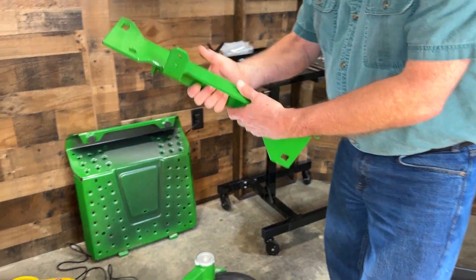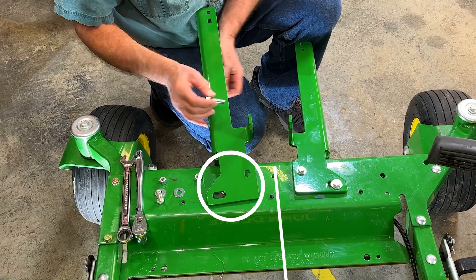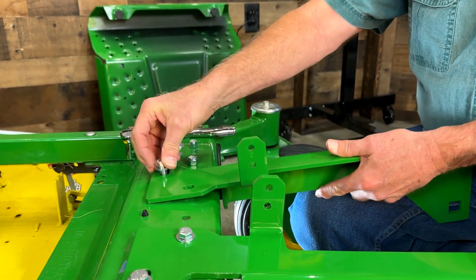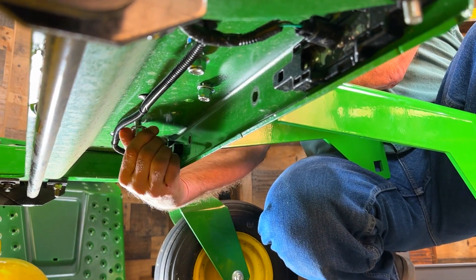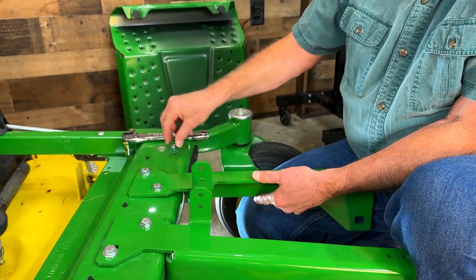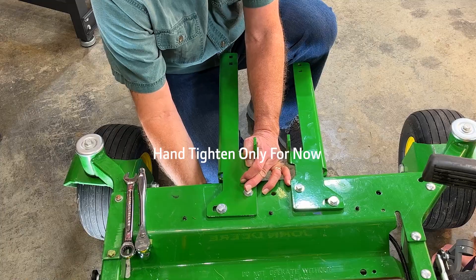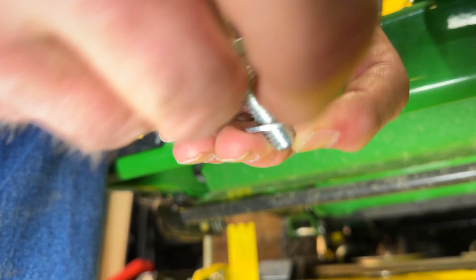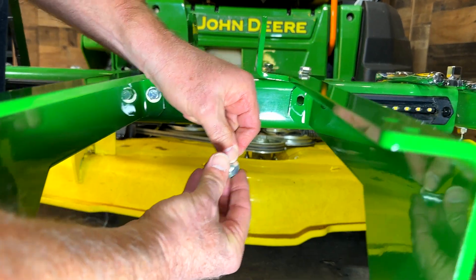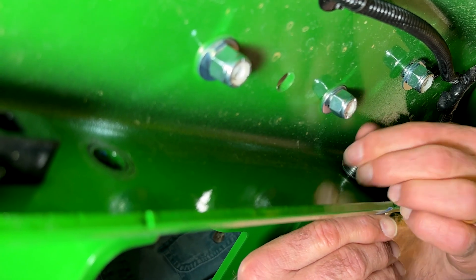Then repeat this step on the other side, lining up the two holes on the flat side of the left mounting bracket with the two diagonal holes just left of the center hole from the driver's perspective. Add a washer to a 3/8-inch by 1-1/4-inch bolt and pass the bolt through both pieces, adding a second washer and lock nut below the deck. Repeat with a fourth bolt, hand tightening only. Then connect the mounting brackets to the front of the mower by adding two washers to two 7/16-inch by 1-1/4-inch bolts, passing them through the holes in the brackets and the front of the mower, adding a washer and lock nut to each bolt — hand tightening only for now.